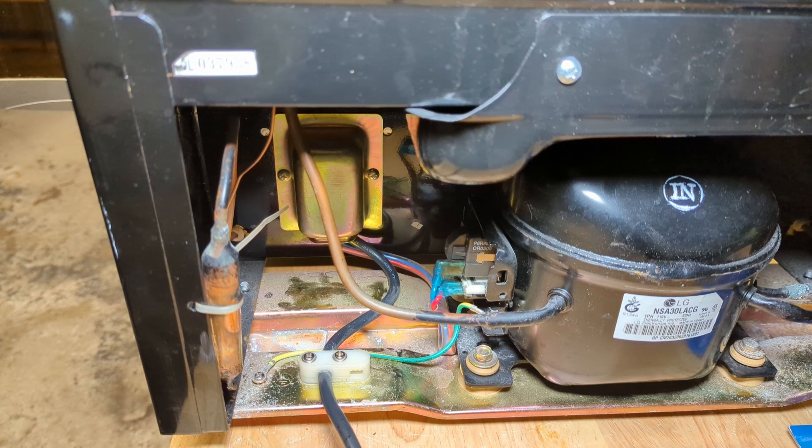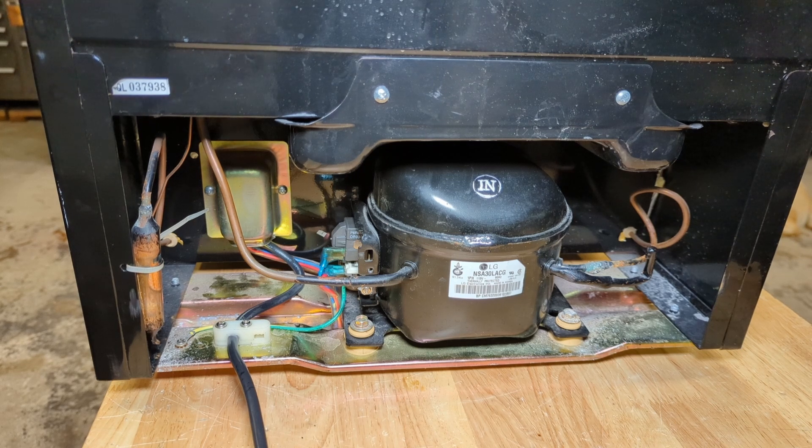I'm going to button it back up inside and let it run for a while. We've got the inside buttoned back up. Looks like whoever took it apart broke one of the little mounts on the plastic housing for the computer, but it's not a big deal - it's secured by a screw, it's not going to go anywhere. So that's all buttoned back up. This is a pretty easy fix. I know I've done a few videos on these things. I see these wine fridges at the curb all the time. People give them to me - they don't work, they get fed up, they take everything apart, they get nowhere. And in the end, so often it's that stupid little starter, a.k.a. PTC relay - call it whatever you want, it's all the same thing.